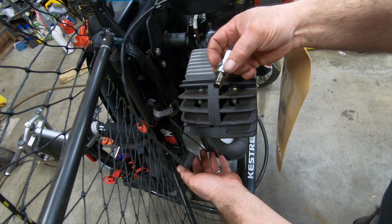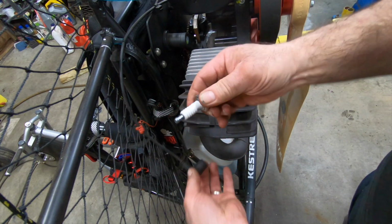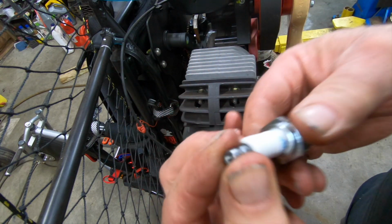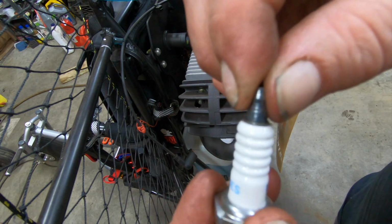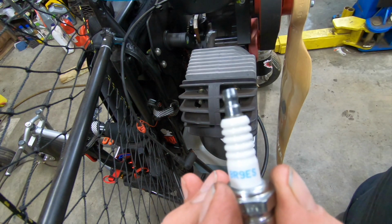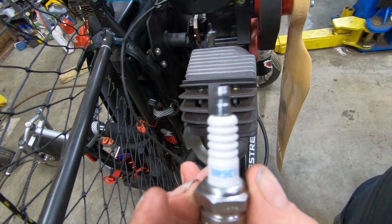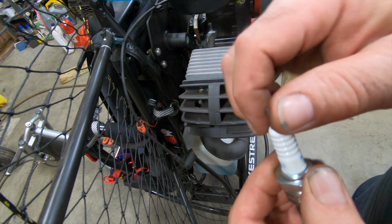Okay. Temperature sensor's free. Make sure this is tight. On paramotors, you want to make sure this is tight because this will come off. 90% of the time, these are loose. It's not a huge deal in a car or a dirt bike because you're on the ground, but if you're going to be flying something, that's something you want to look at.